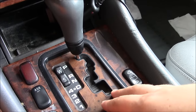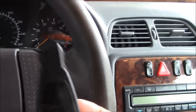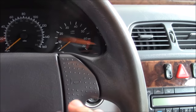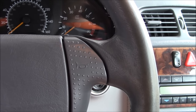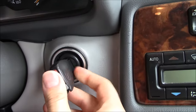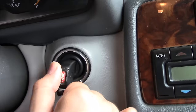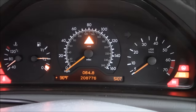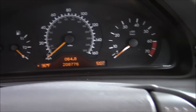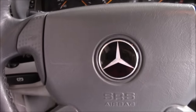Here's how you do it: before you put the key in the ignition, push the gas pedal all the way down — there is a click, push the pedal past the click and hold it. I don't want to do it to my car because I like how it shifts. While still holding the gas pedal all the way down, turn the key to the on position and hold it for 60 seconds. After that, the transmission has been reset. For the first 40 shifts, make sure to drive how you like your car to shift.